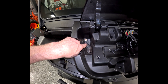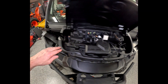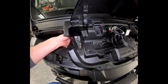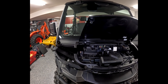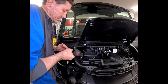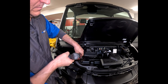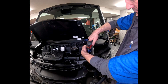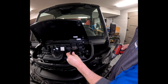Next you have a 10mm bolt here in between these others, and a 10mm bolt on this side as well. You also have to be careful — there is a spacer on the back of this piece of plastic under this bolt that holds it off the frame, so you don't want to drop that spacer and lose it. There is also a washer you don't want to drop.